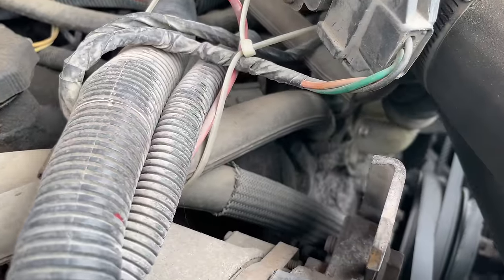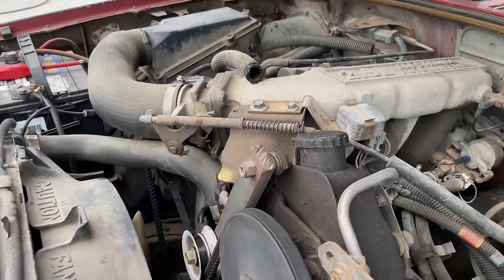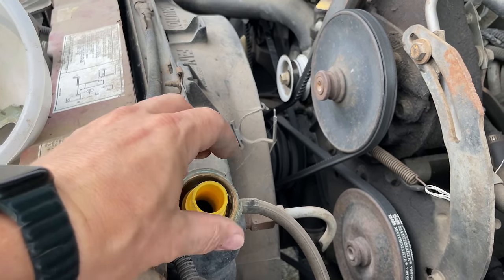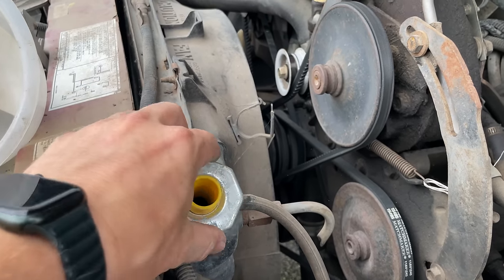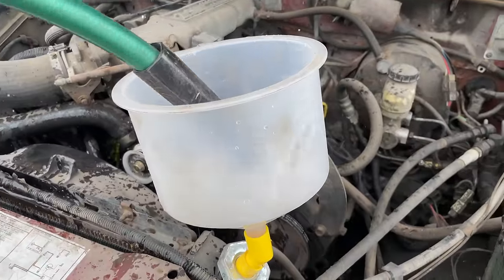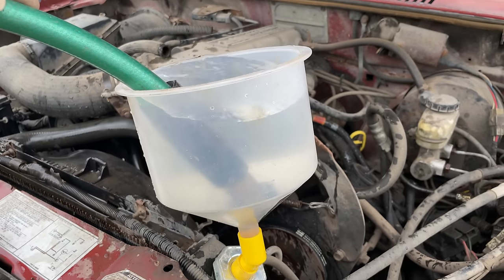Actually, it looks like it won't be too bad to pull the heater hose off, so I'll pull that one — the other hose comes right from the pump. Now with that heater hose off and my coolant drained, I can put on my spillless funnel. It just attaches here to where the radiator cap goes. I can put my garden hose into the funnel so that we have a constant source of water, then I'll start the engine to circulate this through.